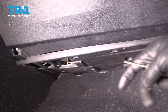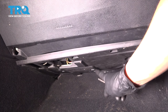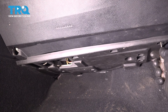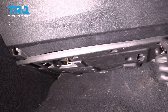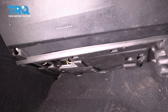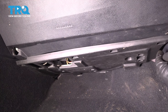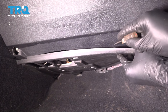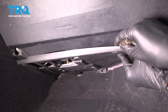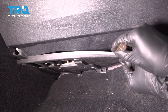Underneath the glove box, you'll see this panel here. This is what we have to remove to get access to the blower motor, which is behind it. There are tabs here that if you just pry towards the firewall with a pocket screwdriver, they should unlock and allow you to pry this down. Now, if you can't get to them from underneath, I'll show you another trick — you can peel it down a little bit and then press the tab with the screwdriver like that.